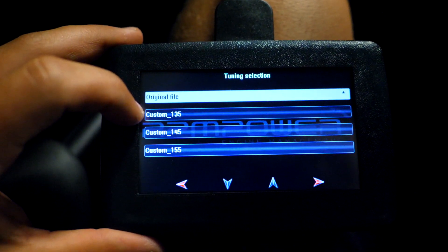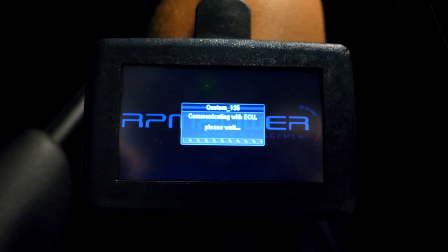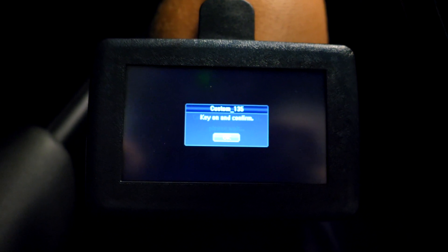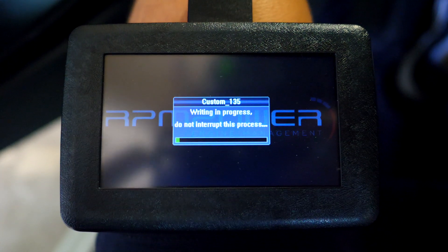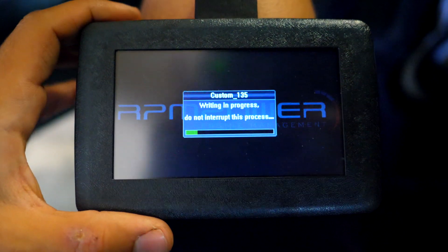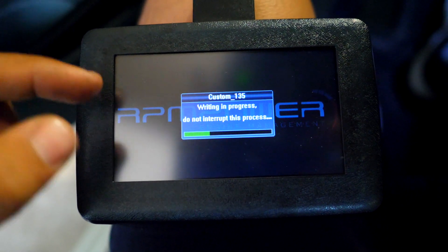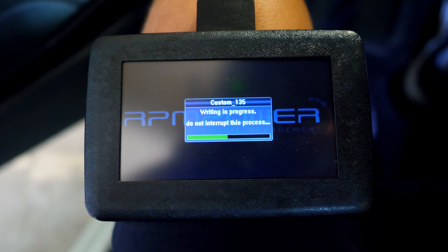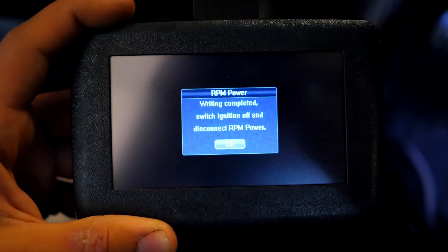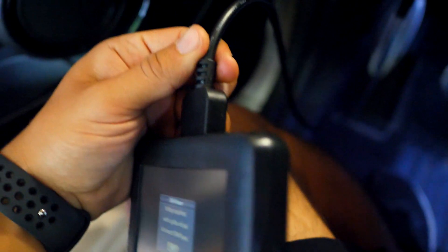With the module back in the car, go to Tuning, check the tuning file, continue with writing the file, yes. The top map is the stock map; the next is 1.35 bar boost, then a little more, then a little more from there. We'll start with map one — 1.35 bar — and upload it to the car. Key on, engine off, then key on and confirm. The module writes the files to the ECU — a progress bar shows the information being transferred. Once done, the car should have the base tune at 1.35 bar, ready for all the hardware I have.